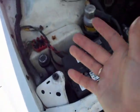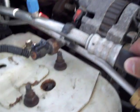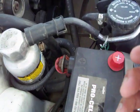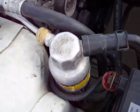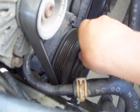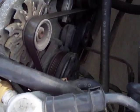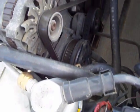First things first, I'm just going to try to explain how this works a little bit. You have refrigerant called R134A in these lines. This is what cools your system down and it's basically the main coolant in it all. This also doubles as like an oil or lubricant in the compressor. My compressor is right there, and on the outside of this is the clutch. An electronic signal goes to the clutch, which is basically a magnet, and it forces the clutch to spin. Sometimes your clutch won't engage and that will make your air conditioning very warm because the compressor is not even on.